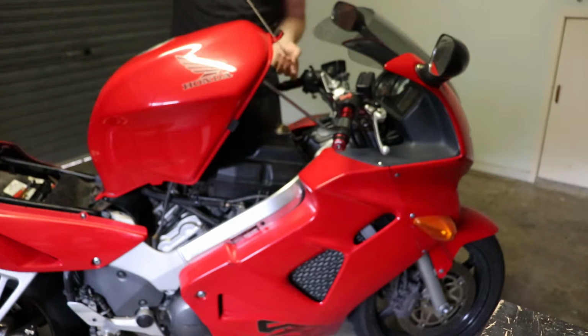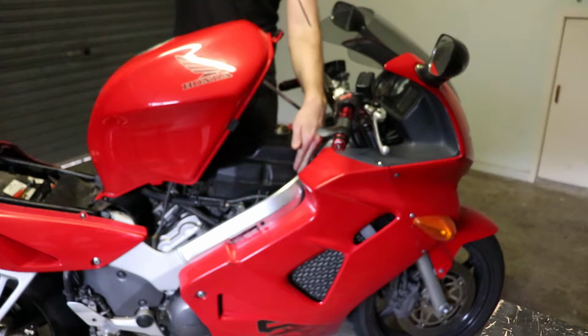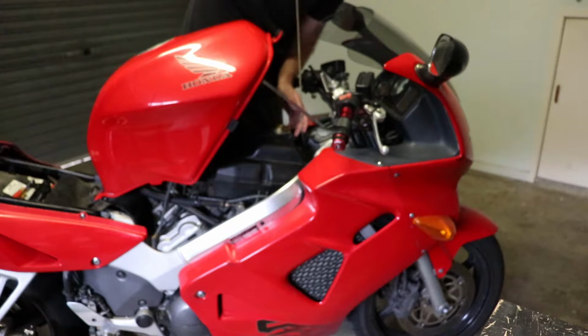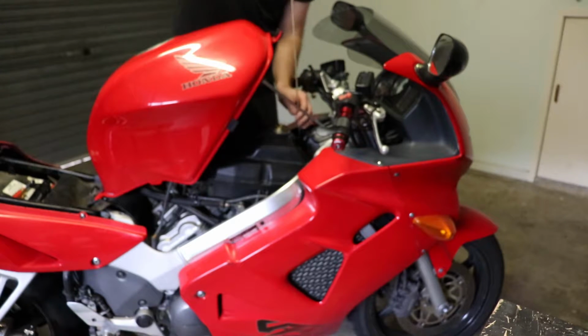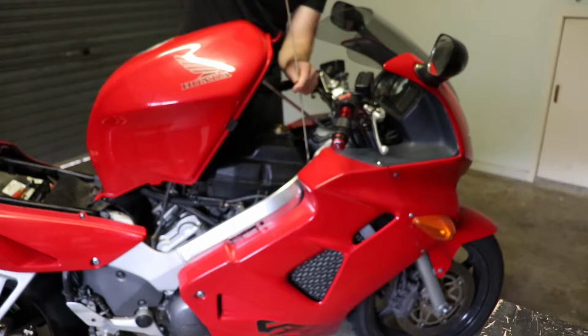So with this tool here, access the 2 front bolts, because there's not much room, there's pipes in the way and the frame's up close. So you use this extension tool like a claw, come down from the top and just extend the fingers out on it, and then you're able to unscrew the screws from the last bit. Saves you having to drop them down in between the engine and the frame.